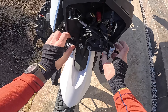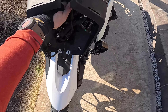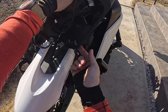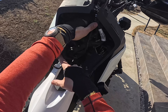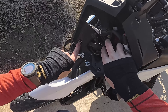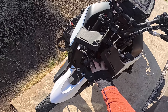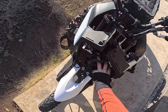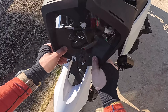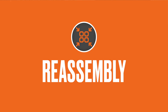The other thing is these bolts that hold in the headlamp right here — actually these nuts. These are just literally pressed into the plastic. So what that means is you don't want to be really tightening these down hard. Also, you want to be very careful about stripping these out, because you can't replace these — they're pressed inside here. I accidentally stripped this one out, so what I had to do is I had to re-tap it. Thankfully, re-tapping it actually worked and I was able to save this part from getting ruined. But yeah, you cannot replace these — they're pressed in there really really hard.